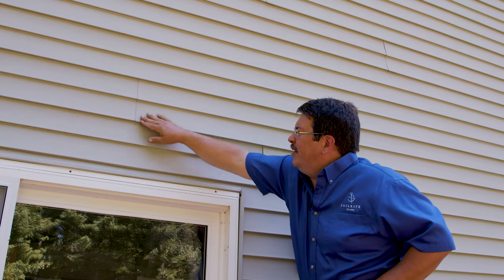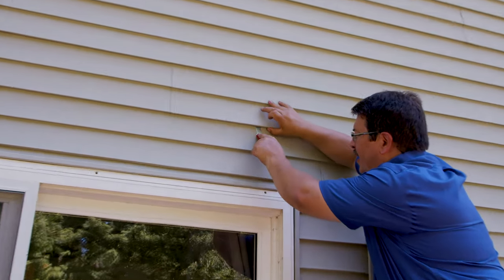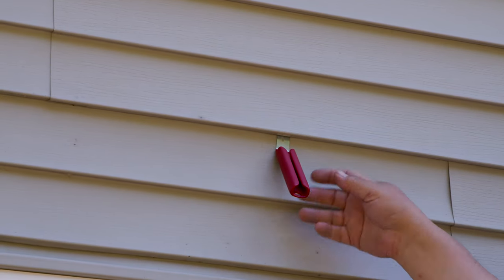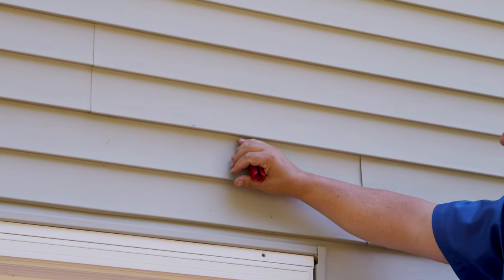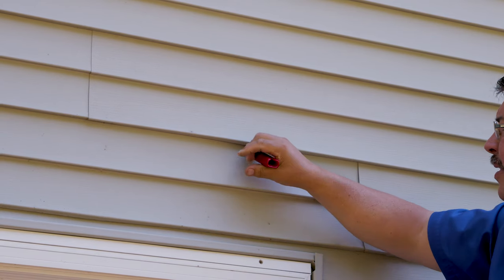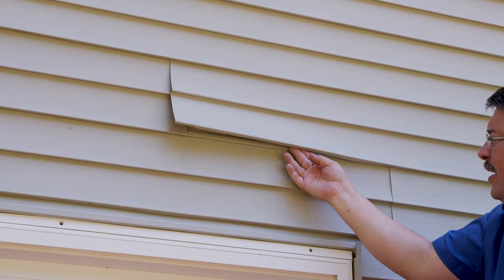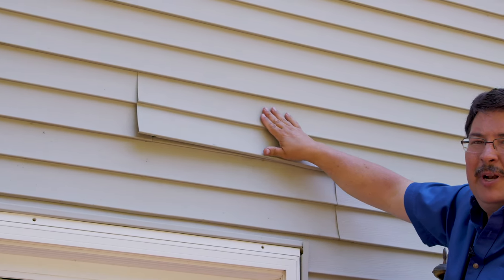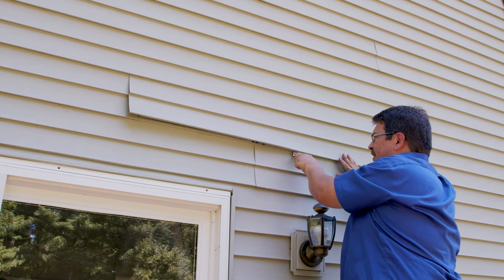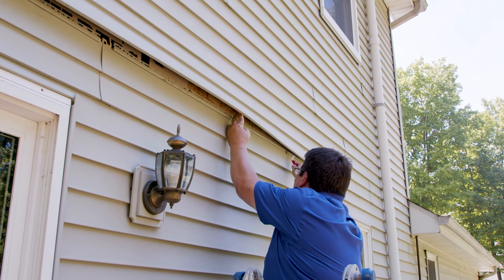I'm going to put it right up here. You can see the joint here. I'm going to take my tool and insert it in the bottom here and lift up. You've got to be careful if the vinyl is old — you don't want to crack it, so do this gently. I'm going to pull down on the tool and pry up a little bit to get that J clip out. There it's out. I'm going to pop it out a little bit further. Now I have access to the underside. I don't want to take down this panel completely — I can clip it back in if I'm careful. I'm going to come down the length and unclip it to the point where I want to put the eye in.